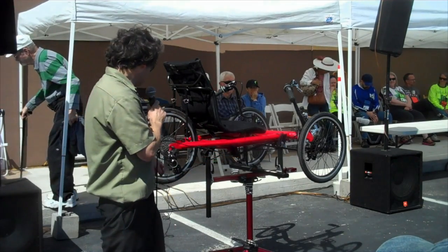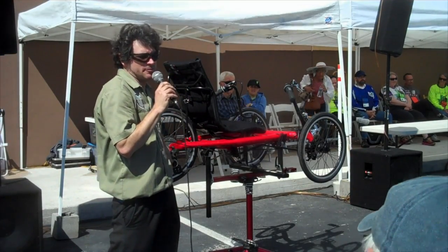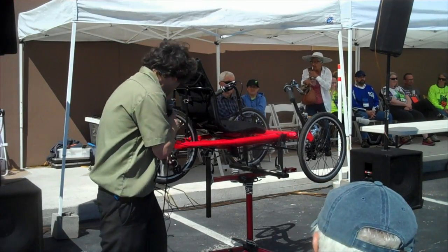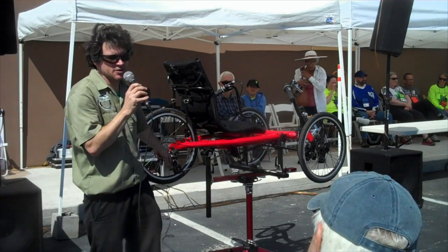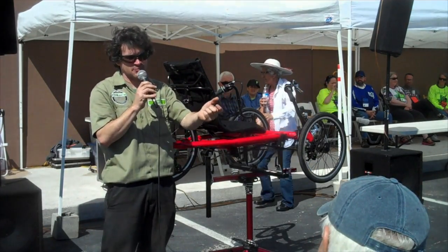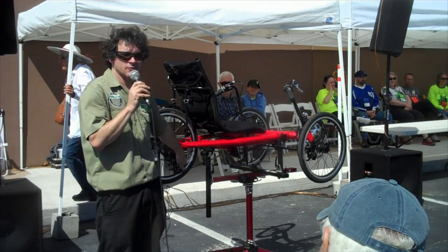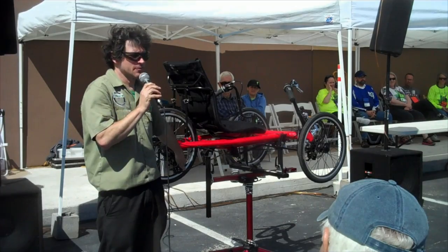So you'll want to look at that when you put it in the low gear and check the gap. It should only be a few millimeters distance. You really shouldn't have whole complete links of chain spanning between the cog set and the top pulley on that derailleur. So that's something to look at.